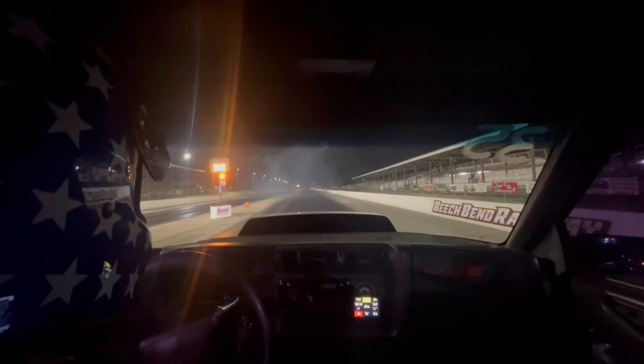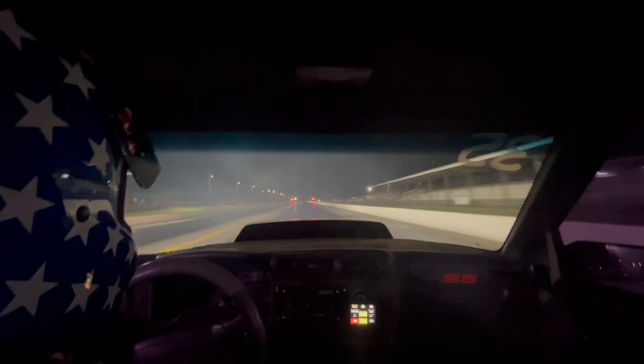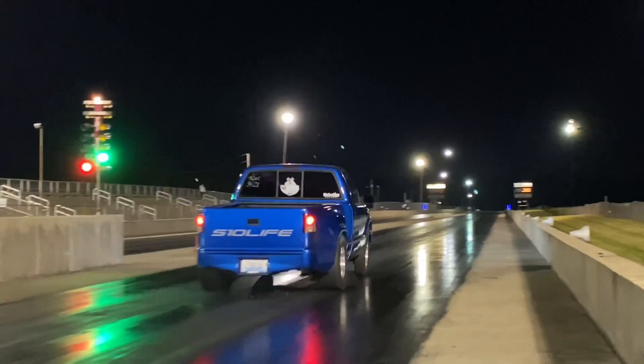I think it's doing pretty good. All motor with a 4600 stall it went 1.56 60-foot, 7.22, 95.27, 11.36 at 118.3. Not too bad — and that is naturally aspirated. The best 60-foot we had with the 3500 converter was a 1.59 on a 100 shot — it went 6.78 at 103. So we've been faster to the 60-foot all motor just with this new torque converter. The results have been promising.